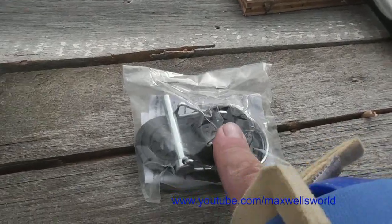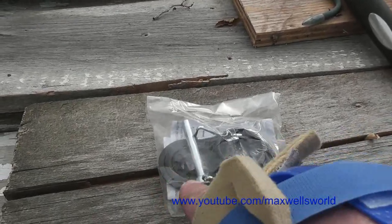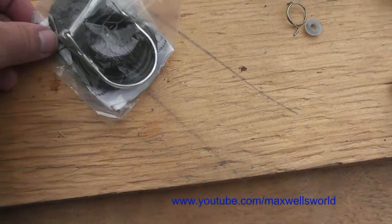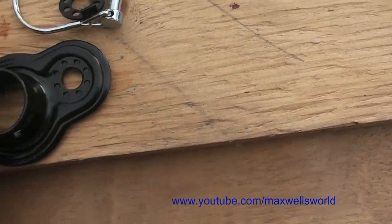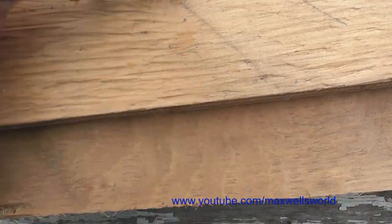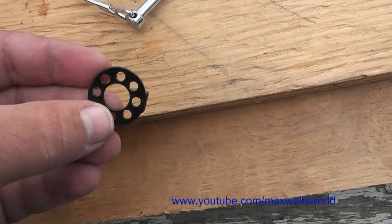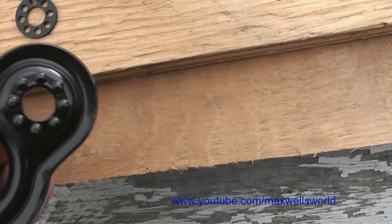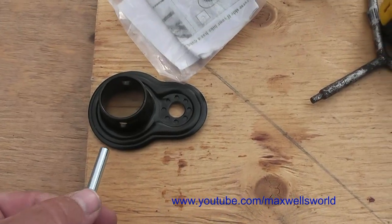So of course he brought it to me, and with a little bit of online research I found the piece we were looking for. Basically this is a little coupler that bolts onto the back axle and adapts the trailer to the bike. You have the main piece, a lock washer that locks it into place with a series of holes and corresponding bumps on the back of the plate, and then a pin that slides through to match everything up.